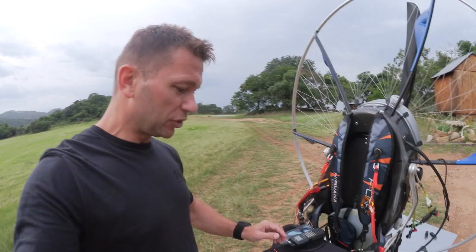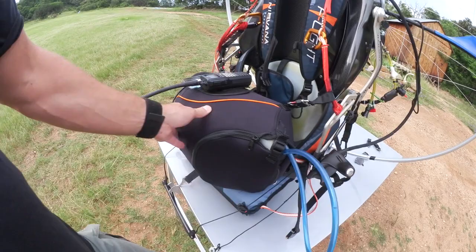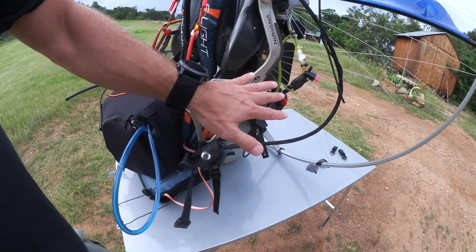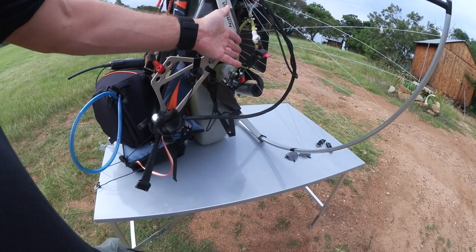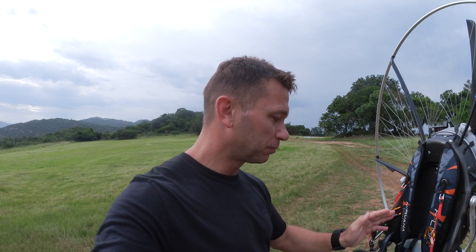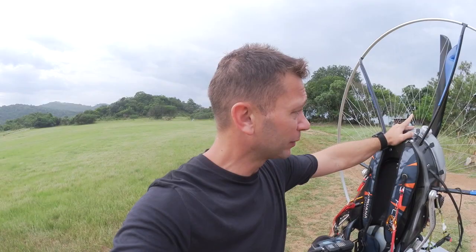What you're noticing here is a standard Nirvana reserve tank, but this is no reserve tank on this trip — this is my cargo compartment. On previous Icarus races I always used side-mounted pockets or bags that gave me 10 liters of carrying capacity each. The problem is it obstructs airflow when it comes around and the engine runs harder, so I had to build a special piping system to redirect air and keep the engine cool. I did that in the Icarus X and the machine still performed valiantly, but I did need that redirection of airflow otherwise the engine would overheat.